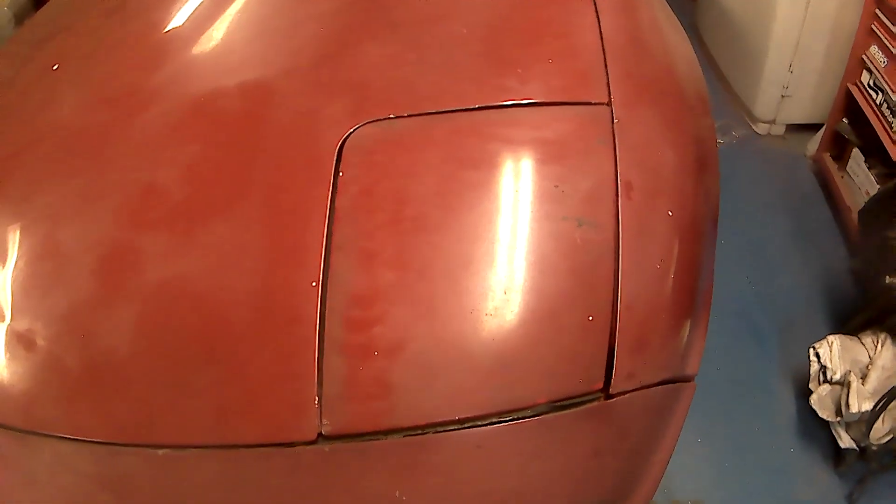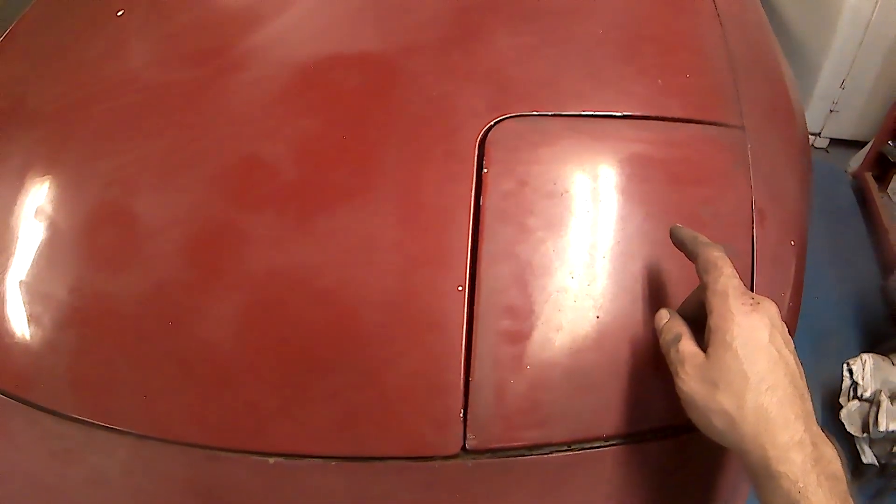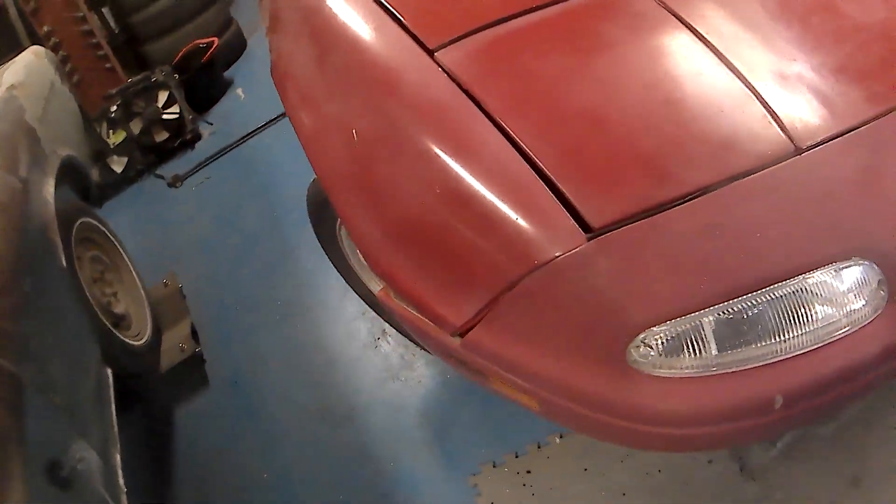After lots of playing around, adjusting the three bolts inside and bending the tabs, this is a pretty close fit already. The plan now is to remove this power steering rack and depower it because it leaks.